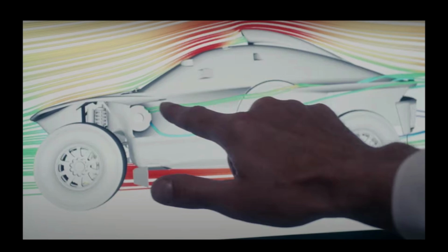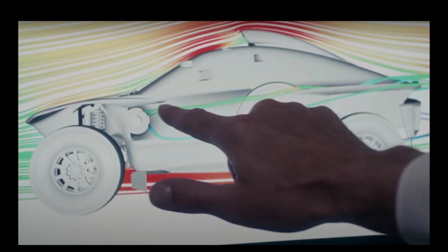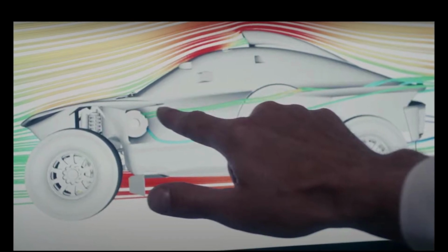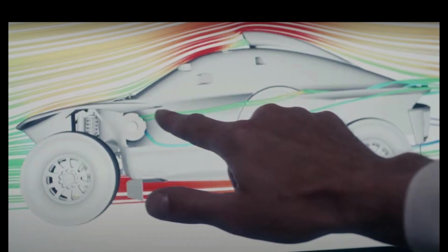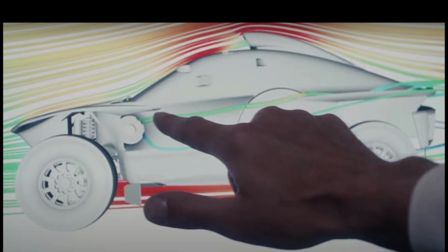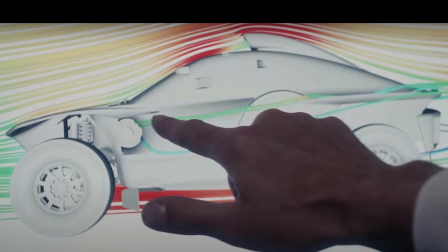The lines are colored by speed, which means that red shows you higher speed and hence lower pressure. We can see that, unsurprisingly, the low pressure peaks are on the roof and on the roof scoop. Although Audi got rid of their strong shoulder line, the dirty front wheel wake does not hit the side windows. The complex front fender is making sure of that.